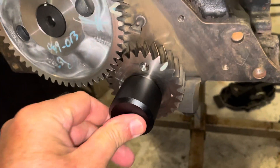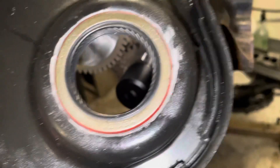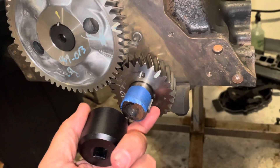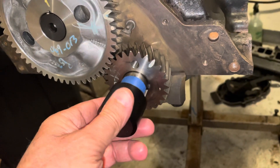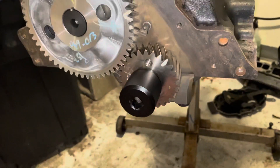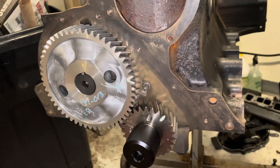I've been using it to rotate this engine as I built it. An added bonus is that the outer diameter of this tool just so happens to fit the seal on this cover. So instead of having to install the harmonic balancer to get this cover centered on the crankshaft, I'm using this tool. I've got one layer of blue tape wrapped around the crank because when it fits on there it's just a tad loose. With the tape on there, it's a very snug, concentric fit on the crankshaft. So when I put this timing cover on, it will be concentric with the crankshaft and I can tighten everything down with full access to all my bolts.